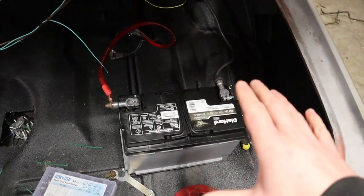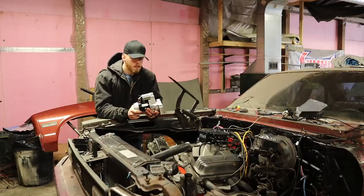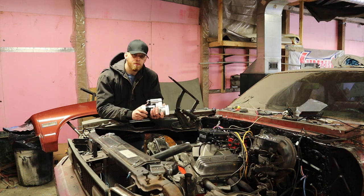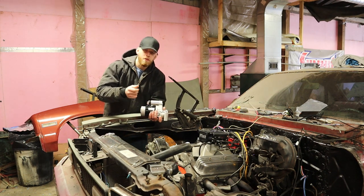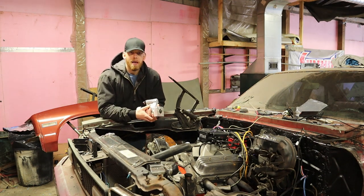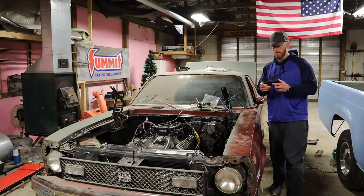It's been a several-day fiasco but I did get a new AGM style battery — I think it's just going to be a lot better performing, especially for this setup. I also ordered a high-torque starter from Summit Racing — I'll put the part number in the description. Whenever I was cranking it over the starter started to smoke, so there's definitely some kind of issue with the starter. We're hoping we don't have to take too much apart — at most we'd have to take the headers off — but we'll figure it all out.